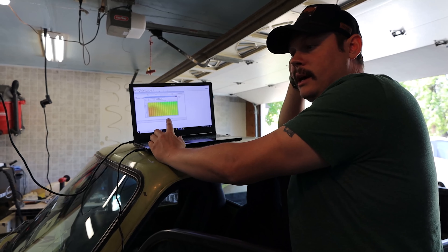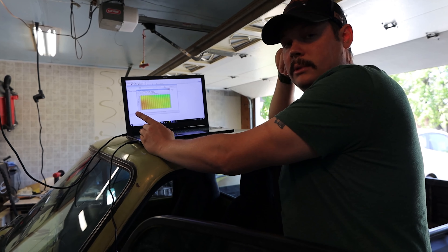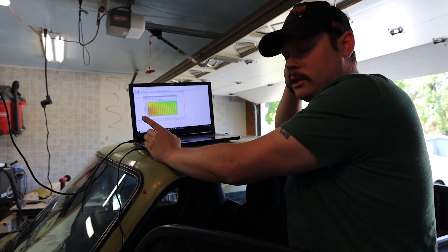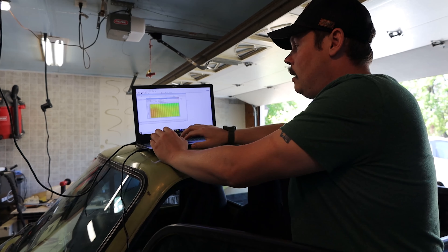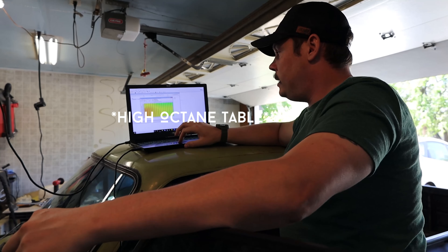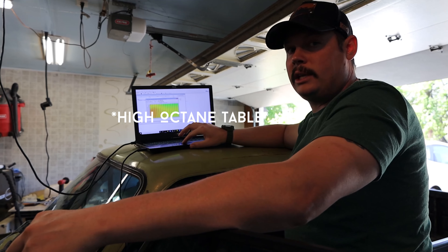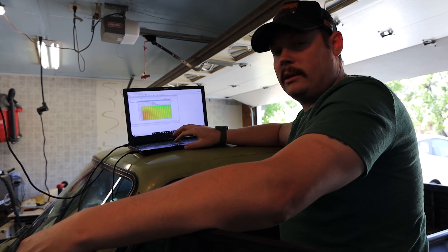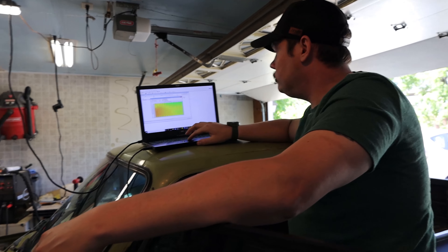The only downside is the delay it takes for the air temp sensor to cool down, but he does have a fast-response air temp sensor, which should make a big difference. For an all-out race application you'd rely on that; for daily driving you'd use the air temp sensor table. We're going to take it out for a quick spin around the block and gather some data.